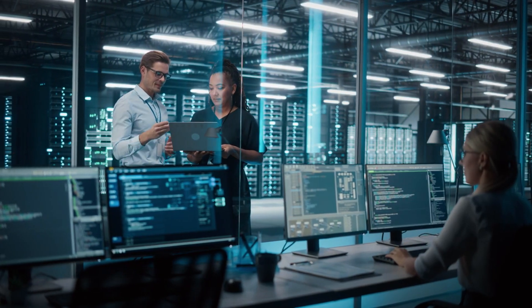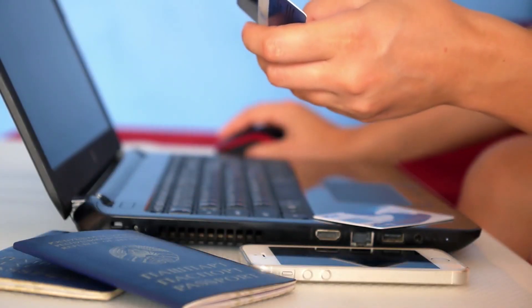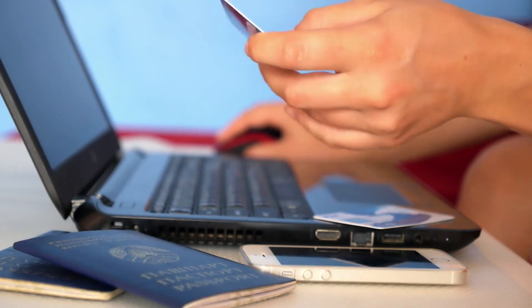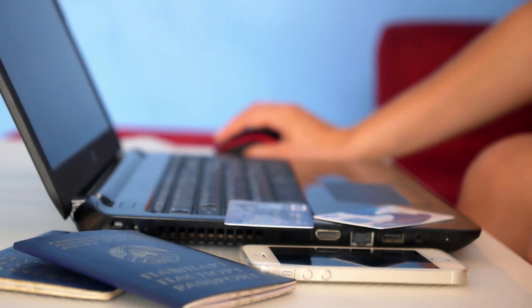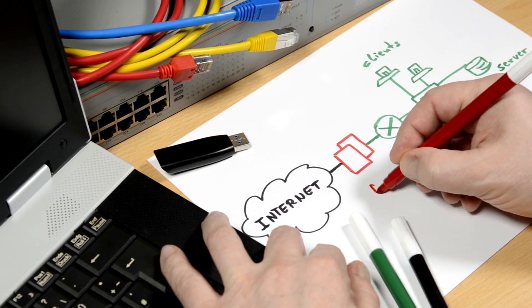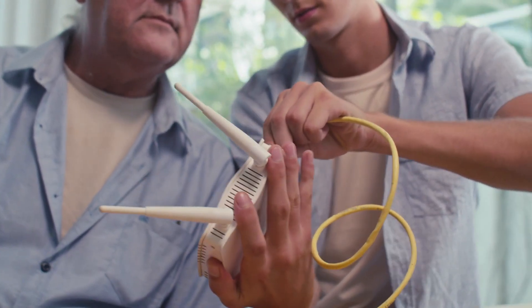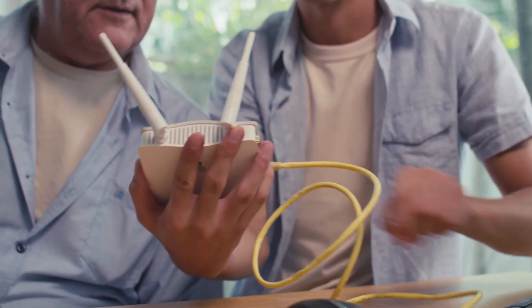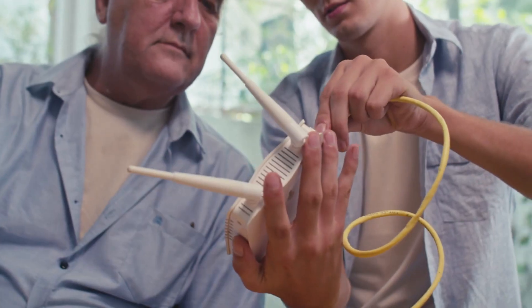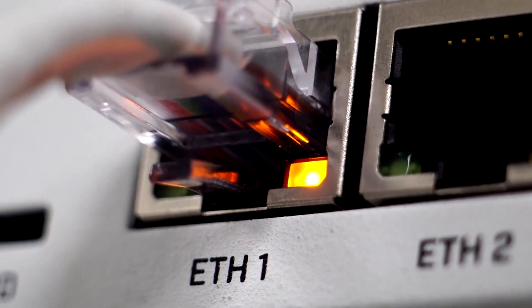Let's run a scenario. You're on your laptop watching a YouTube video. Your laptop sends a request to YouTube's server. This request heads to your router's LAN interface, gets NAT translated, forwarded out the WAN port to your ISP, then the Internet backbone, then the YouTube server responds. The response arrives back at your modem, then your router checks the routing table, matches the NAT session, and forwards to your laptop's private IP via Wi-Fi radio. Physically, the incoming Ethernet frame hits the Ethernet switch chip, goes through the processor with memory lookups, then gets sent via the RF module's digital-to-analog conversion, amplified through the antenna, wireless propagation, and your laptop picks up and decodes. Now repeat that for dozens of devices and multiple streams — you see why router hardware matters.